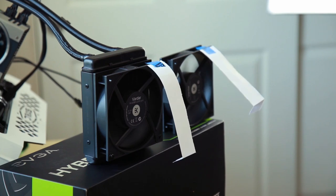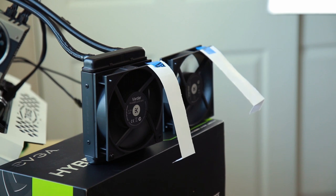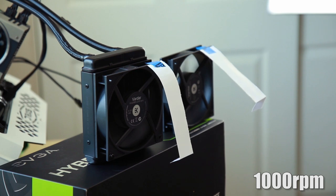What you're looking at right now are two identical EK Waterblock Vardar 2200 RPM fans hooked up on a PWM splitter on the same PWM circuit, so they get identical voltages and RPMs. The one on the left is hooked up to a high-density 30mm thick 120mm radiator, and the one on the right is in an open-air config with no resistance in front or behind. I'm showing you this as a visual aid as we increase RPMs through pull, push, and push-pull configs. Temperature testing will be shown in a chart at the end.